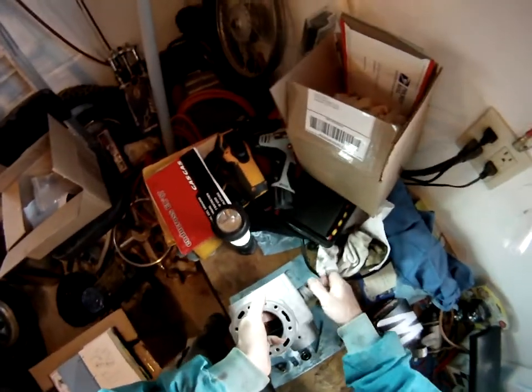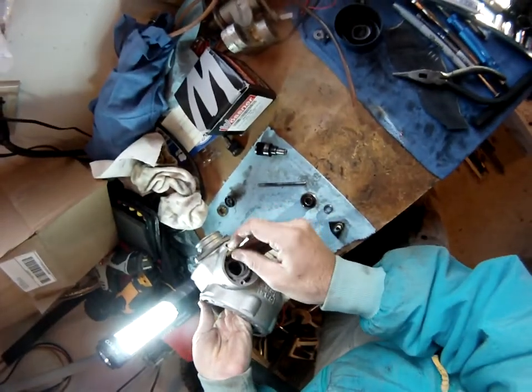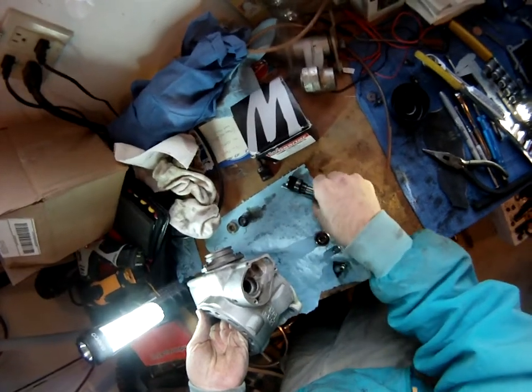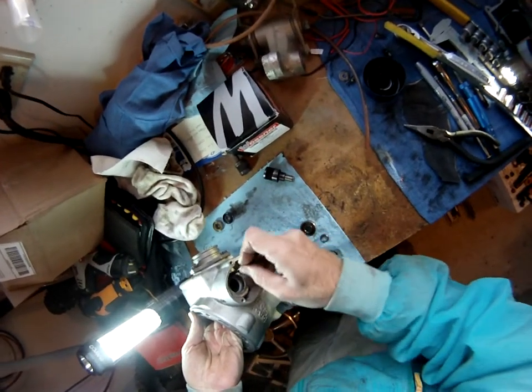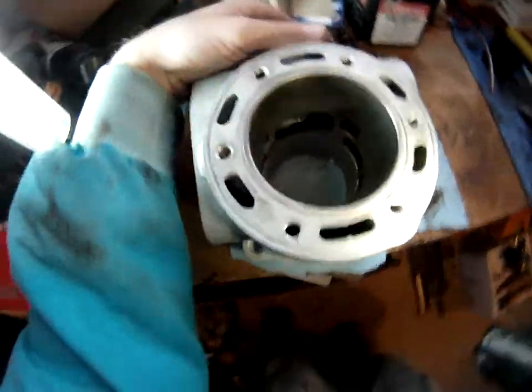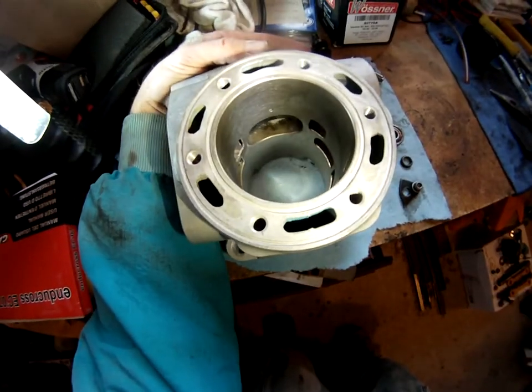So we've got the long rod. Put the power valve up inside and the long rod goes in this threaded hole. Just pushing it a little bit farther. Okay, so there's the power valve closed - hopefully this is showing up in the video, sorry the lighting's terrible. Power valve open. Closed, open. So that's indexed appropriately.